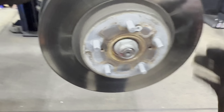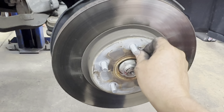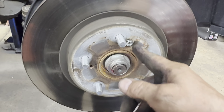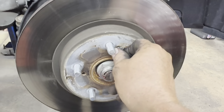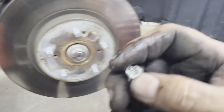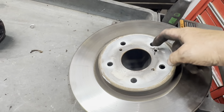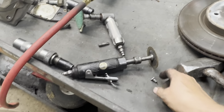Then you need to remove your rotor. It's got those Phillips head retainer screws and they always strip out. I try with my impact driver first, then I use a chisel and hit it to the side to get it loose. If that's unsuccessful, you'll need a die grinder — cut an X on it, then use a chisel or a flat blade screwdriver to remove it.